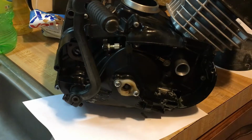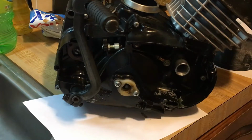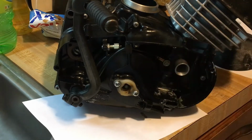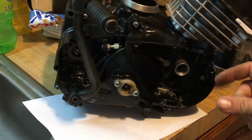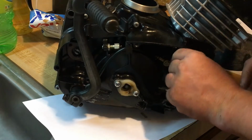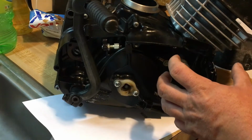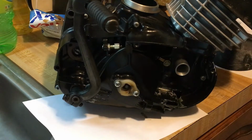The modification on this thing is going to be minimal. It's really not that bad. Like I said, a 1-inch spacer. We may end up cutting down the intake a little bit, taking about 1/4 of an inch off, because there's an intake tube, and it's about that big, and it's going to slide over this intake. It's going to have a clamp here, and then the carburetor fits into the rubber boot, which has the carburetor sticking out further. So we're going to have some modifications. We might have to modify the air horn to fit as well.